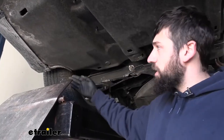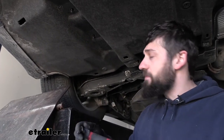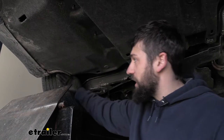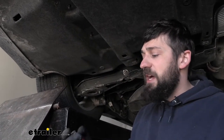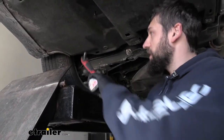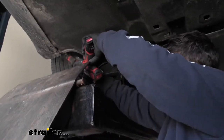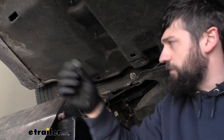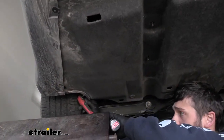The next part has three additional fasteners up here that are really hard to see — we're going to use an eight millimeter socket. There are two on the bottom edge of this panel and one at the top, so just feel for them. You'll probably need a quarter inch drive socket and small ratchet, or if you have a swivel tool you can use an impact. They're the same little screws removed from the outside of the panel earlier, three of them tucked back in there.